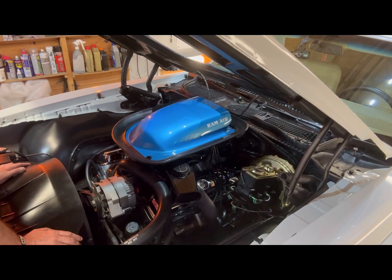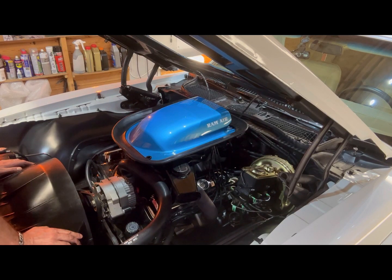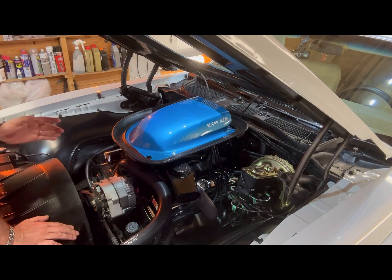While doing this work I've discovered a couple of other little things that need doing, which I'll share in future videos. I found a vacuum leak on the intake manifold, which needs to be sorted. The car has had a very annoying tiny flat spot just off idle that I've been chasing for a while — I've done plugs, fuel filters, checked the accelerator pump, and checked the operation of the choke. While the cabling was out, I sprayed some carb cleaner and sure enough it picks up a vacuum leak on the driver's side — only a small area of probably two or three inches, but clearly enough to be sucking air and causing that flat spot.